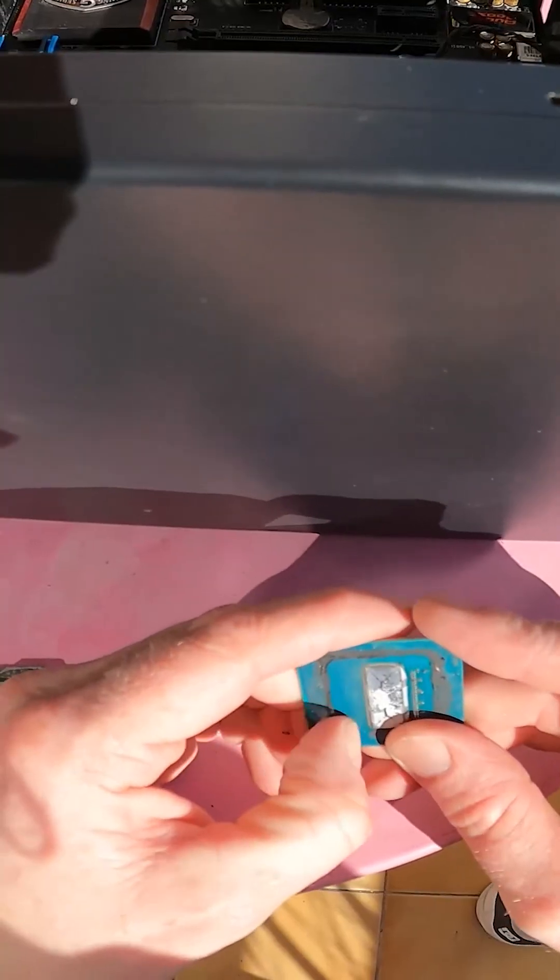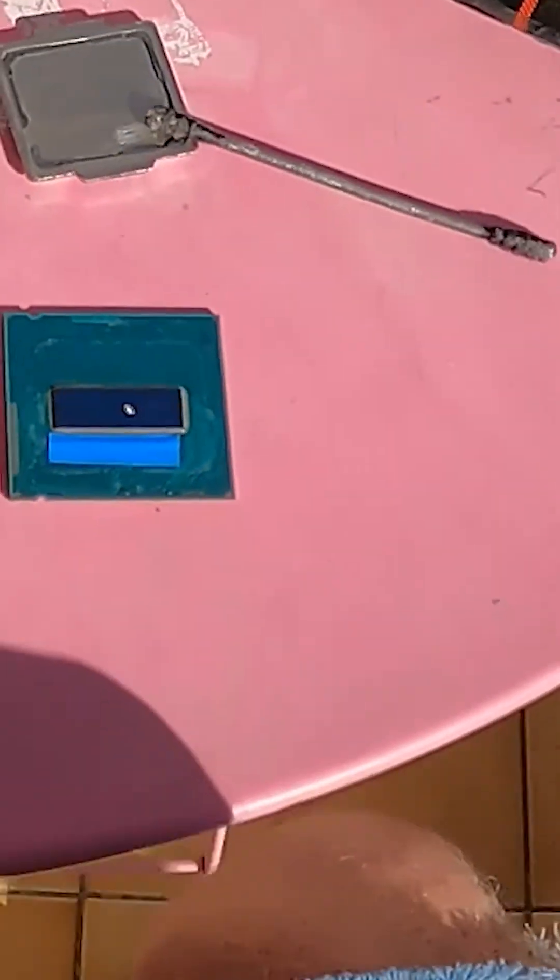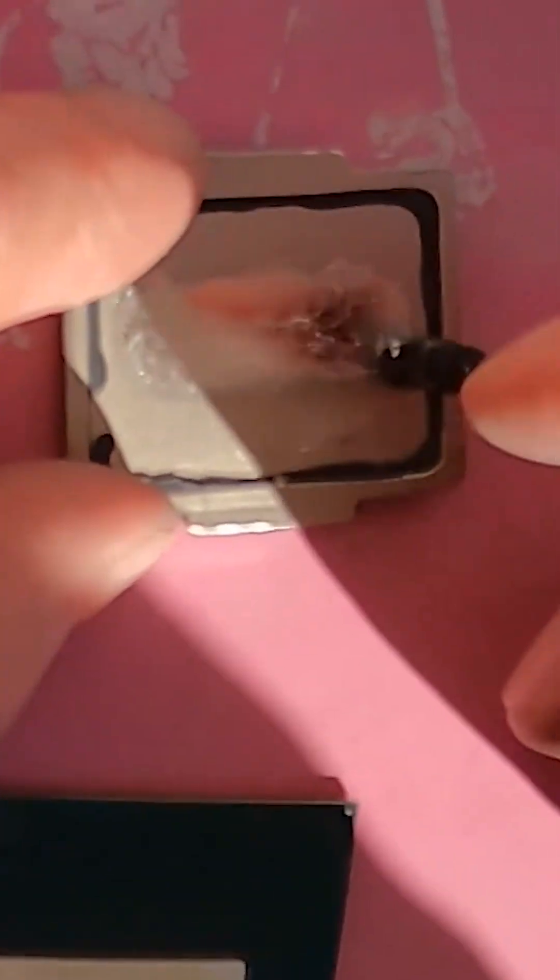See how dry that is? I'm going to pick all this glue off. I'm going to put liquid metal — liquid metal conducts electricity, so put some tape across anything that's conductive under here. Just remember, it spreads further than a gymnast doing the splits.